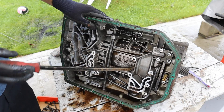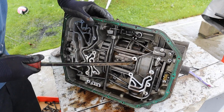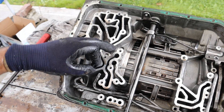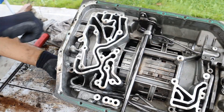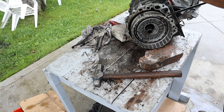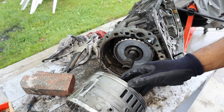There's a spot to pry the next set of clutches out — seems like the first set kind of pressed in there. I need to release some of these hydraulic lines. The secret is to get these little rubbers out of these two holes and then slide this front piece out — but my hands are slippery again. Make sure they're always clean. This piece might have been press-fit or splined inside here; that's why it took so long to get out.